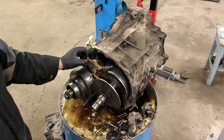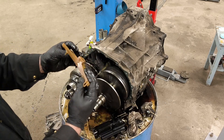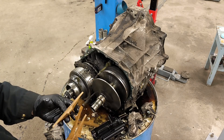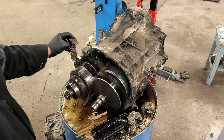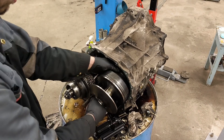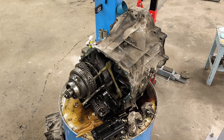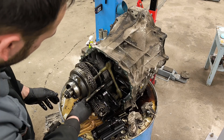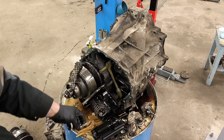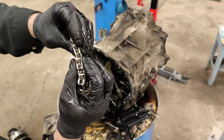I have a damaged gearbox. As you can see, the guide is coming across and it's not closed off — it's all torn apart. Maybe it broke now, but I saw one place where the chain broke fully. You can see the guide — this chain — is up there. This damage, this old surface is bad, so it's not from normal removal. It happened before. You can see this pipe has damage from the chain which was turning over and probably became a little loose. This is only a small piece of the chain — look at this, unbelievable.